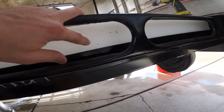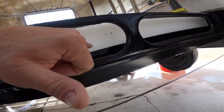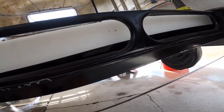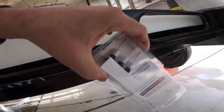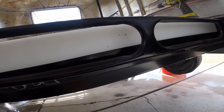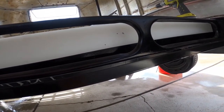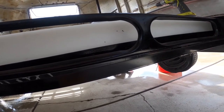All right, now that we've got our tank level sensors marked, we'll go ahead and use a 3/8 inch drill bit, drill out each one of the four holes, and then go ahead and put the tank level sensors right into those, tighten them down, wire them up. So I'm going to put this camera in a position that you can watch me do this, and we'll get this work started and finished. Should only take probably 2 minutes.